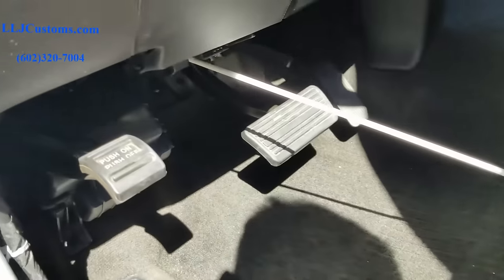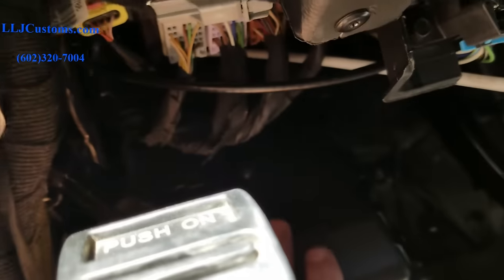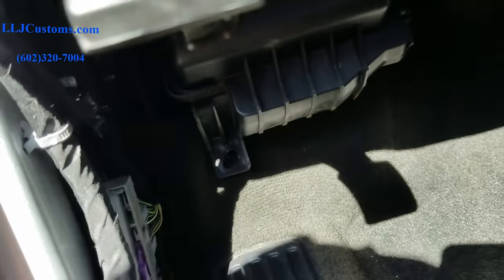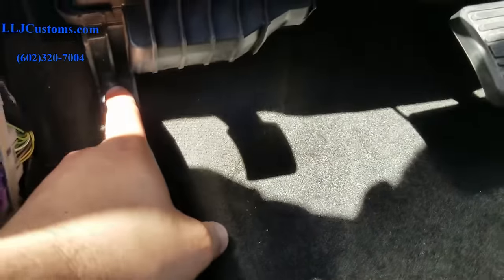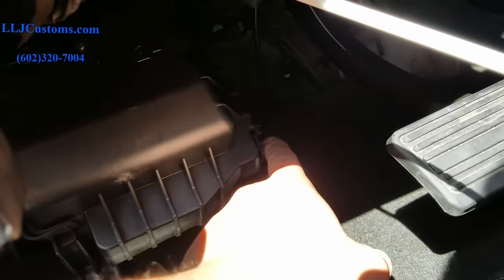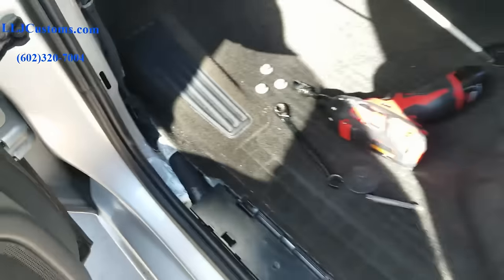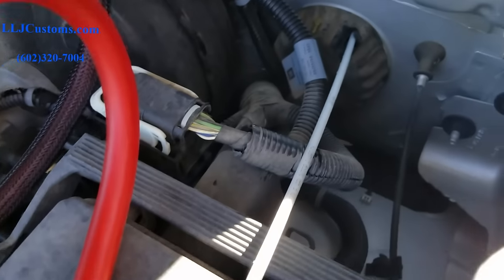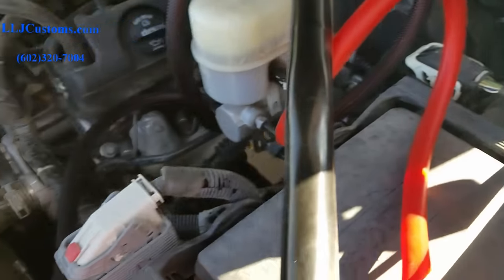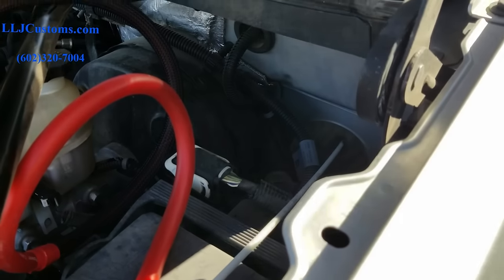So we're gonna go ahead and take this seat out. This is how we pull the power wire through — there's gonna be a grommet on the other side. There's this black box here that's gonna have three 10mm bolts holding it. You're gonna want to remove the bottom one, then there's one more all the way back there about three inches, and one right above it — you'll preferably need a ratcheting ratchet for that one. Then we're gonna make a hole through the grommet, spray some electrical contact lube so it'll pull through, and pull it into the cabin.